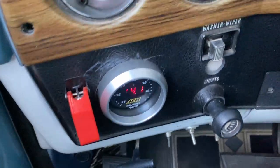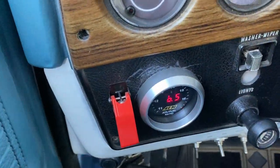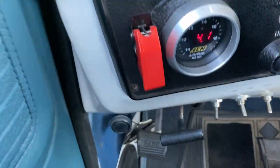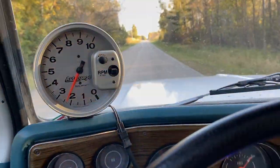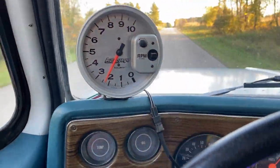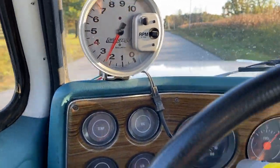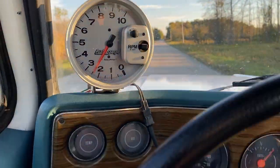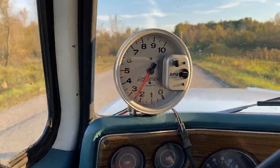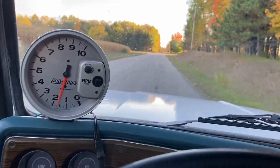Left, floor it here. It gets high on the gauge when I let off because there's obviously no fuel. That first run it got pretty lean — that's when it goes from quarter throttle to half throttle. When it went from about quarter throttle to wide open, it actually did pretty good; it got lean for a second when the blades opened up but then settled out. So now I'm going to test out a full hit. I'm going to throw the GoPro on to get a different angle so you guys can see — sorry if the quality dips a little when it switches.